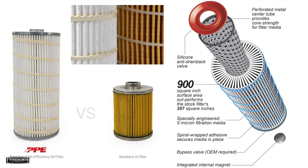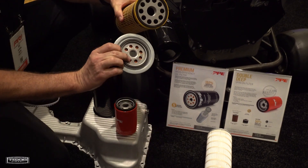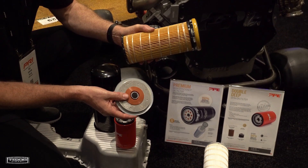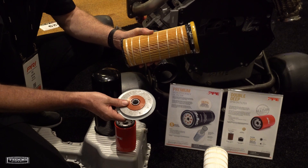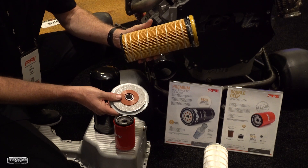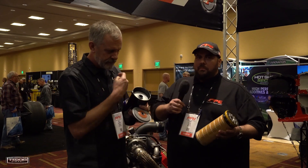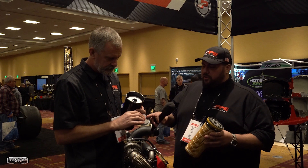There are a couple of other aspects too. One of them being that there is no oil bypass valve in the CAT filter, so when your filter gets clogged over time, there's a bypass valve incorporated into factory filters that allows oil to continue to get into your motor when it can't get through the media. We've increased the bypass pressure spring compared to the stock filter, so there's less chance that you'll be feeding your motor with contaminated oil — that's just an emergency situation if your filter media ever becomes that clogged. With the increased surface area of our filter media, there's a much lower chance that it will ever become clogged between regular oil change intervals.